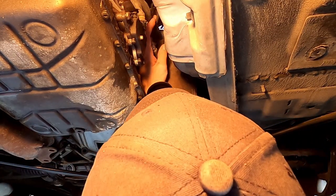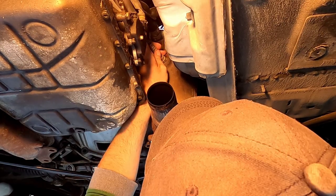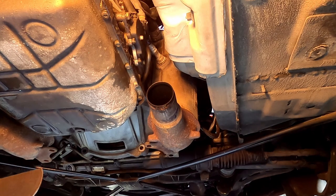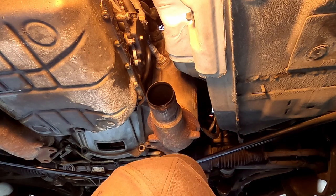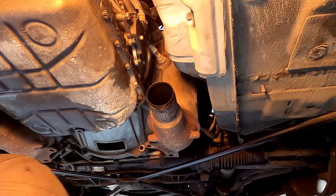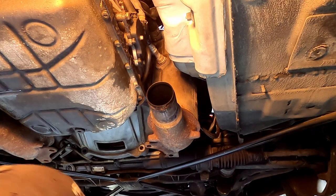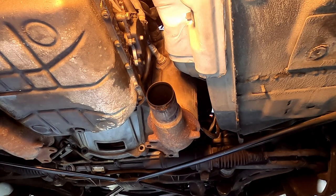One of the things you can come across is the cable wanting to start twisting up on itself if it doesn't have a whole lot of slack. Unfortunately, these connect at the top — they're behind the throttle body or the intake on the very back side of the engine. So for this one, we are going to have to undo that connection because it does seem to be getting kind of tight. I'm going to go ahead and break loose these two lower ones. The one up high I'm not sure how I'll get to quite yet, but it will be easier once the lower O2 is out.